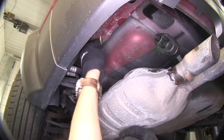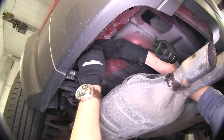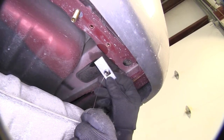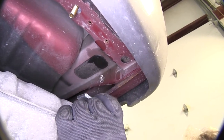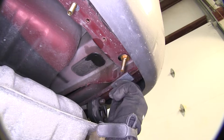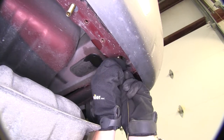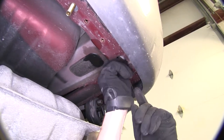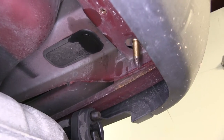Be careful when removing the fish wire because we will be reusing it. It helps if you hold onto the bolt as you thread it off. For this hole, we're going to do everything on the outside and then put it through the hole and pull it back out. Take the fish wire, go up through the block, then take our half inch carriage bolt and thread that on. Push the bolt up through first, then the block, to pull it down through. Then take off the fish wire.